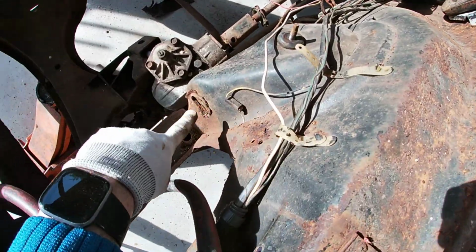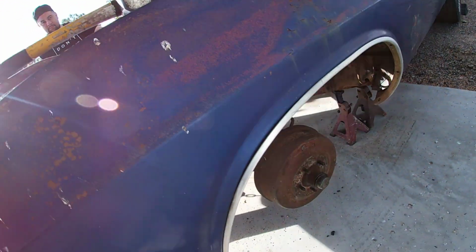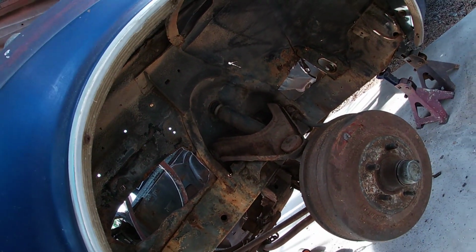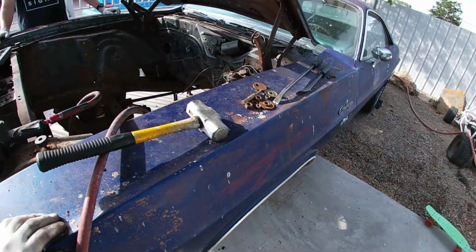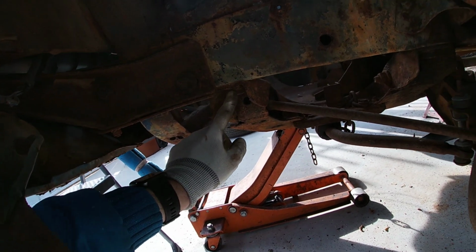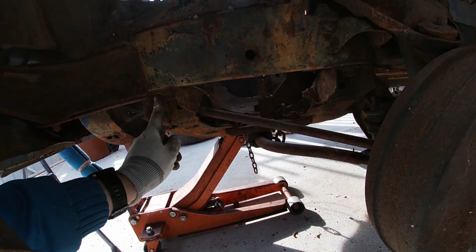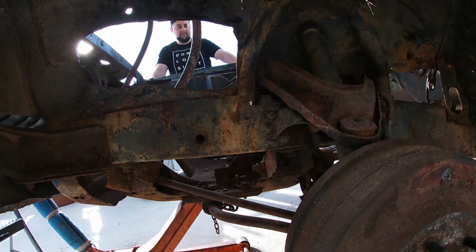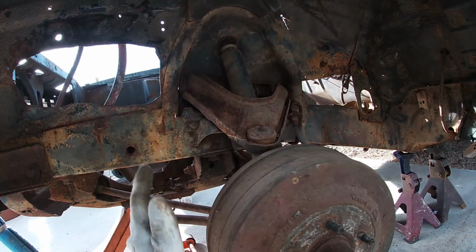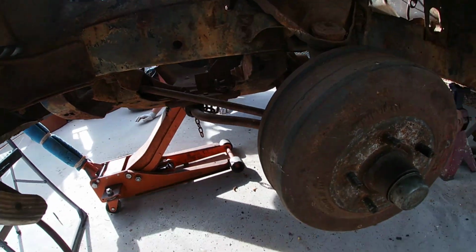Alright, so I went ahead and took the control arm bolts on both sides, the shock nuts here, wheels off. So I think the top of the suspension should be pretty close to coming off. I'm gonna take off these nuts, these big bolts here, which hold the K-member, and after these are off, the whole thing should drop, I'm thinking. So we'll figure it out. And it's gonna come out with everything all attached, brakes and everything, so all one piece.